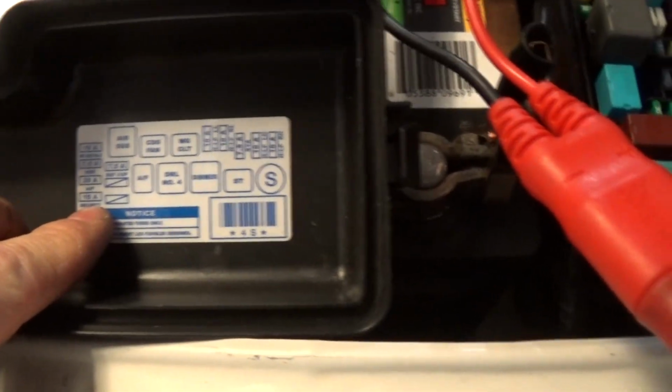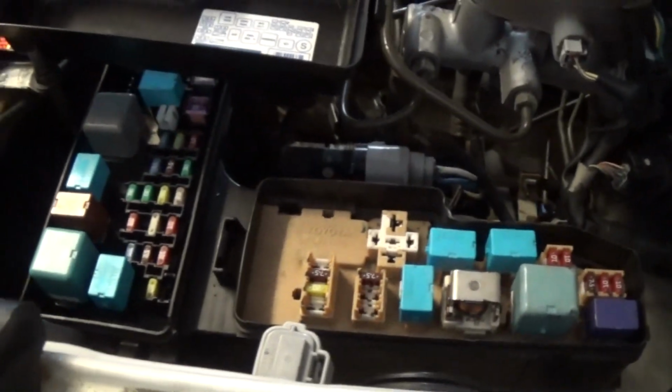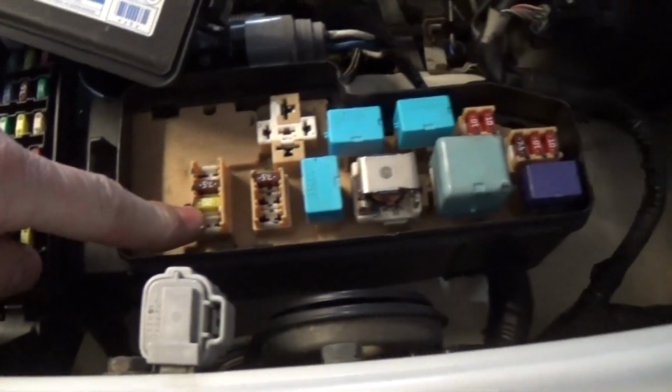So the security fuse is in a small fuse box. It's right in here. And when we look at it, I need to get rid of this thing. Just gonna short something out. Just gonna cut it off. Anyhow, security fuse 15 amp, it's gone. It's not even there. So this fuse is gone, this relay was out, this relay was rigged up. Let's put the fuse inside.